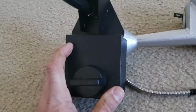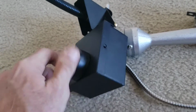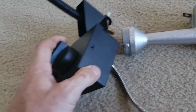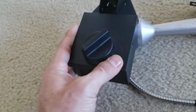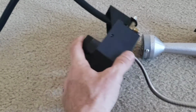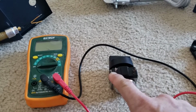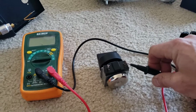Before we even take it apart, I think probably the feature that people most dislike, I'm guessing, is this timer. So, a couple of things. I think one, you could zip tie it or tape it and just keep it open. Drill it, put a nail in there. There's multiple mechanical ways that you could get around that timer with a little hacking creativity. And the second thing you could do is just short the wires that come to the timer across, because that's all the timer does, is act as a switch.